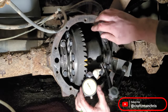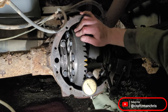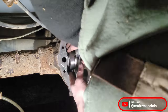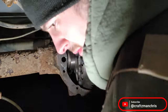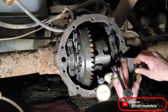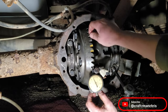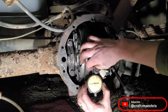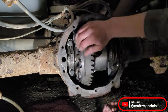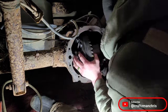The pattern looks decent but I have about 40 to 50 thousandths of backlash. The key to dialing in the rear end is to shim your pinion forward and back to get your pattern centered on the ring gear, and to shim your carrier left to right to get your backlash set correctly. To take up some backlash, I remove some shims from under the right carrier bearing race and add them under the left carrier bearing race. That shifts the whole carrier assembly to the right, closer to the pinion. I check the backlash again and I'm sitting around 15 thousandths.